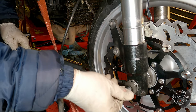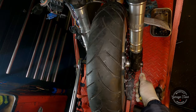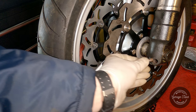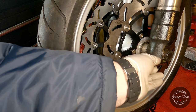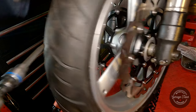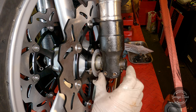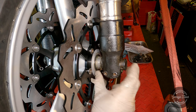Now I can put the bolt in and torque it to spec. Make sure the wheel still spins freely. Add some copper grease to the pinch bolts and drive them in all the way. Before I tighten the pinch bolts completely, I just want to make sure the floating end is floating freely and it's not pulled in as I tap the spindle through. It seems to be free, so I can go ahead and tighten the bolts. The other side doesn't really matter - I can tighten that as soon as the spindle bolt is tight.